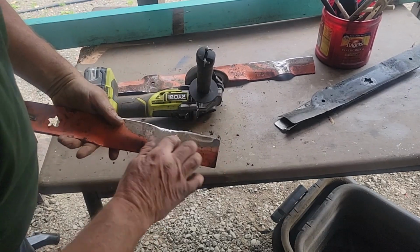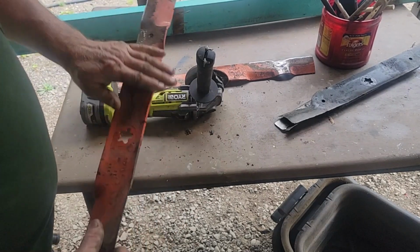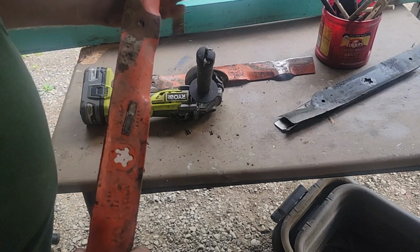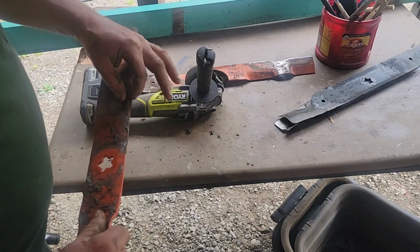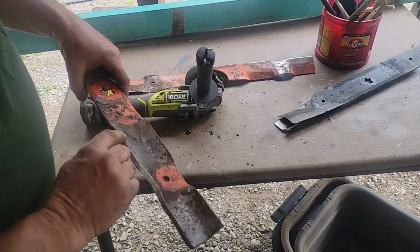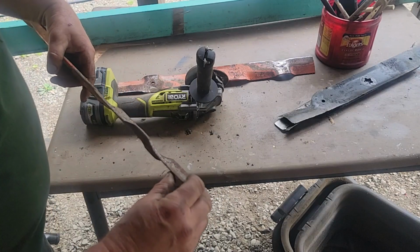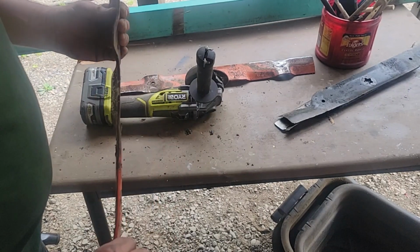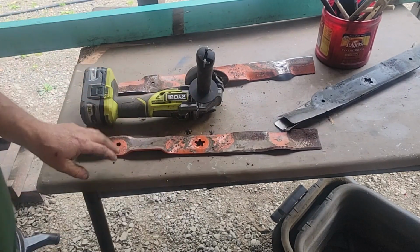but like I said, on the back side, I just want it flat. Make sure there's like no stone burrs. There are a couple nicks in it from a stone, but this is approximately a heavy 1/4 inch, probably 5/16, and I just want to follow that without overheating it. This is pretty sharp right up to this outer edge, so this shouldn't take too much.